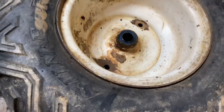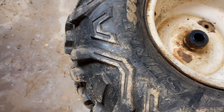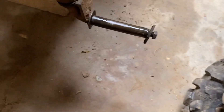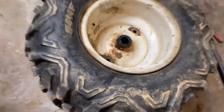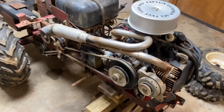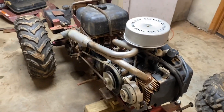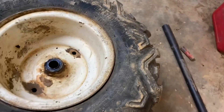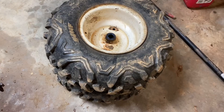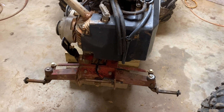Front tires - stock wheels, PG bearings. They seem to be holding up all right. No big trailer hub craziness up here - I just kind of kept it basic. I'm the guy that likes to keep the thing as much tractor as possible. These have about three gallons each of fluid in them. You've got to get fluid in your tires or that thing's going to be up off the ground on anything even semi-steep.